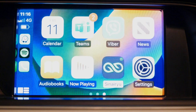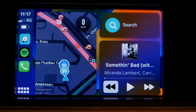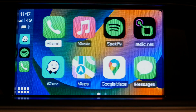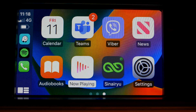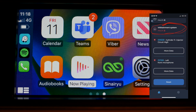You choose CarPlay and you're in — it works pretty well, very good indeed, no issues with phone calls. The unit is thumbs up from the guys that made it; they were very supportive through the installation. During installation, apparently some dirt got into the mic port or it got wiggled and disconnected — I got an error message, 'microphone from left not working,' which tells you the mic connection is not okay. You have to open it again, take it out, plug it back in and it should work.